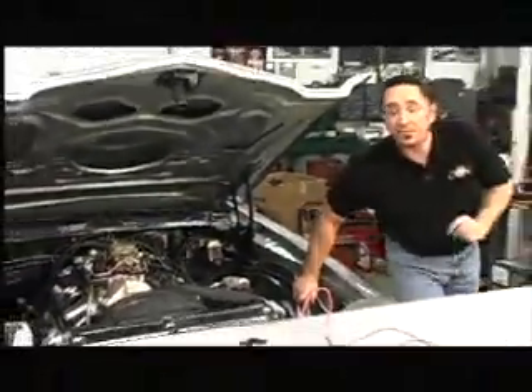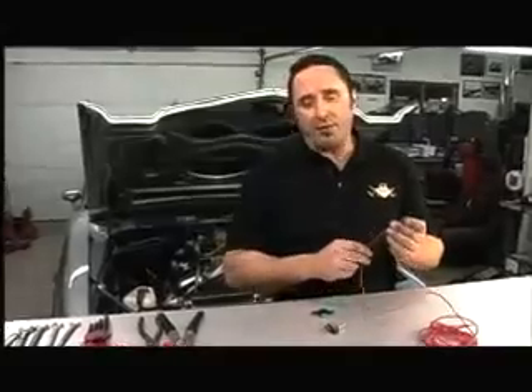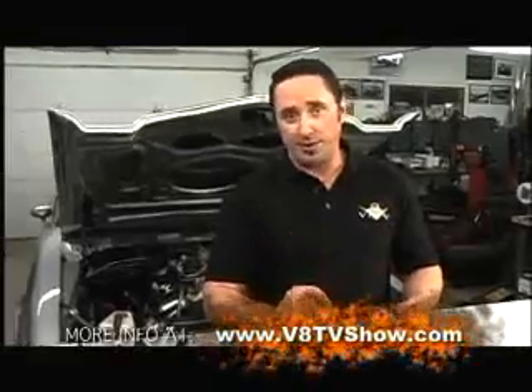The last thing we have to do is get into our fuse box, put a spade clip on the end of this wire, and plug it into an ignition source. After that we take the in-line fuse kit that ZEX supplies, and after the fuse we go right to a master on/off switch. When we flick the switch on, it sends power to our 12-volt source right outside the firewall, goes to our micro switch on the side of the carburetor — meaning that the next time you floor it, the solenoids turn on and you've got an extra 250 horsepower. It's going to be awesome.